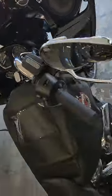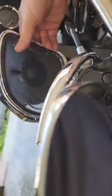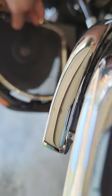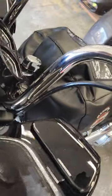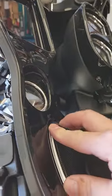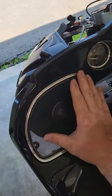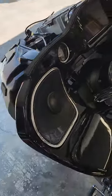Now they're in there — get the grills back on here. They've marked it 'clutch side.' Got the little tabs in place. You're going to plug that little wire up on the top and then slide that edge and snap them right back into place. With the little wire hooked up, tuck that back in behind here and kick it down in this upper corner just to make it easy to pull, snug it out of the way so it's not rattling against your grill. Then get your tabs in place and just snap it right back in. It's nice and clean — you don't have the wire hanging down in here where you can see anything. Beautiful, nice stuff.